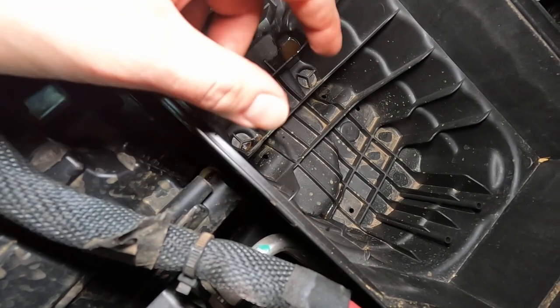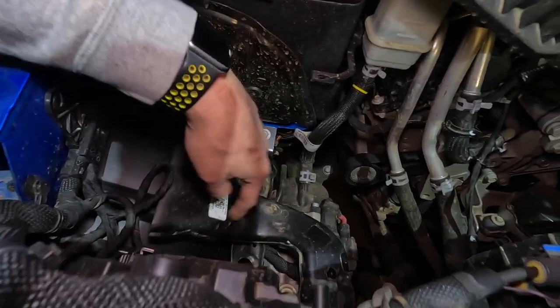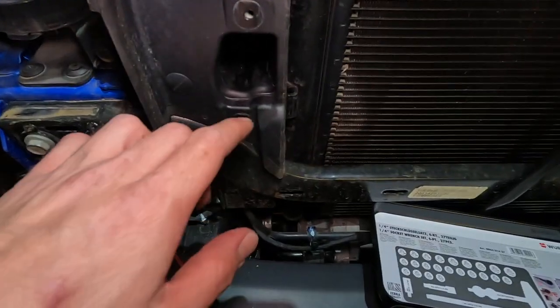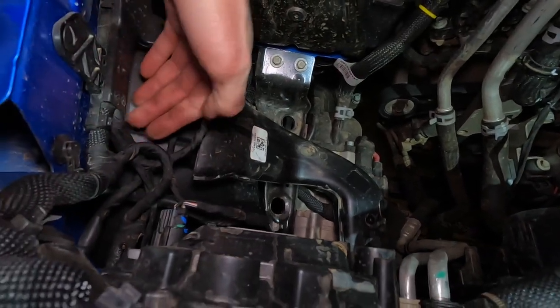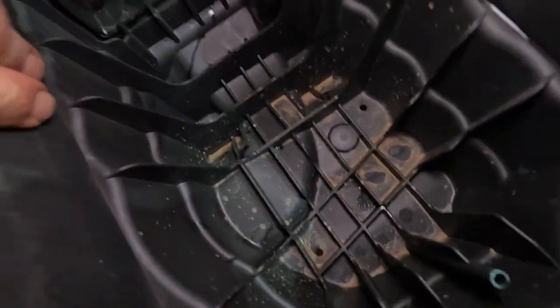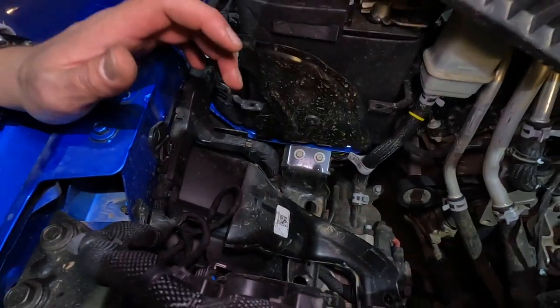The factory air box is super easy to take out — it's basically just the two rubber grommets at the bottom and one bolt on the fender. After that, pull it out. I've always wondered how the stock intake is exactly routed. Basically, in your grill there's an intake tube that goes through here and comes out over here, so you get a mixture of air from your fender as well as cold air from the front. That tube doesn't actually connect directly to your air box — air comes through the bottom, into the air box, which has a few drainage holes.